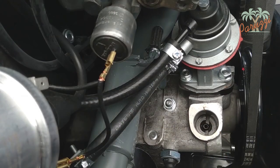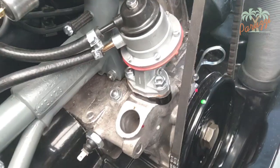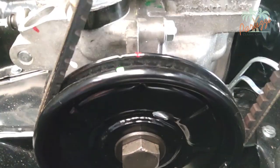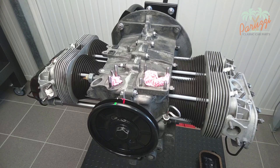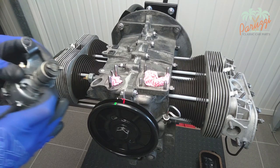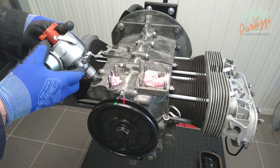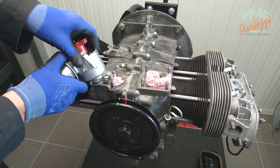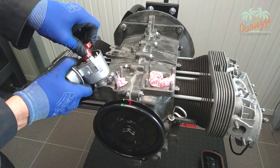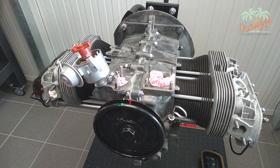We show on our AS1600 engine that the narrowest part of the drive shaft points toward the crankshaft pulley. The red mark on the crankshaft pulley is in line with both crankcase halves. We refer again to video 6 to determine the compression stroke of cylinder 1. Now the distributor may be mounted. Position the smallest half at the bottom of the distributor in the direction of the crankshaft pulley. Push the distributor into the crankcase, turning the rotor a little to get the cams of the distributor to engage in the slots of the drive shaft. We'll discuss replacing the distributor o-ring later in this video series. If all went well, you now have a properly positioned distributor that you can adjust without hindrance.